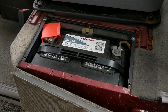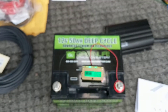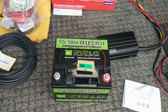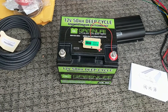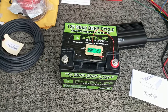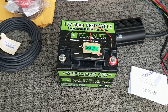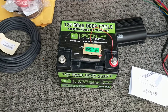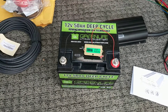That battery is charged in a certain way — the alternator is designed to do an initial super rush of current to charge the battery up quickly and get you on the road. The problem is that's not how you charge a lithium battery. So if you just hook a deep cycle lithium battery into the van with an isolator or the GoWesty secondary battery kit, your main battery gets charged normally but the lithium battery will never really come up to its full potential — its lifespan will be drastically reduced and you'll have spent a lot of money for nothing.